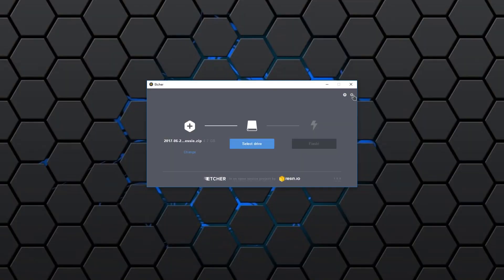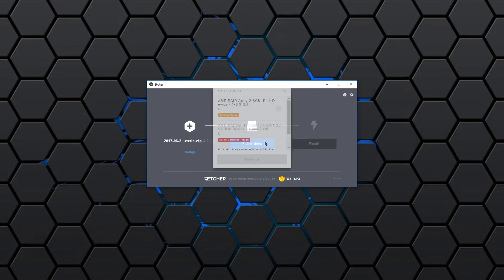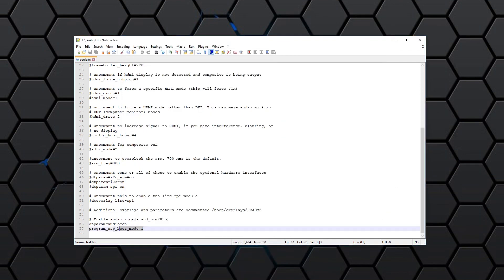Now, if you're using Etcher, you might have to turn on the unsafe feature — just check it off and then you should be able to see your hard drives. Once you burn the two images, don't disconnect them yet. You want to still be able to modify the config.txt files. We're gonna add a little tiny line on the bottom of each one, on the hard drive and on the SD card.